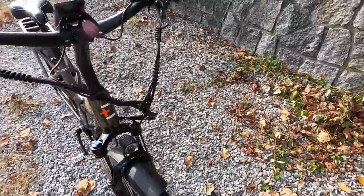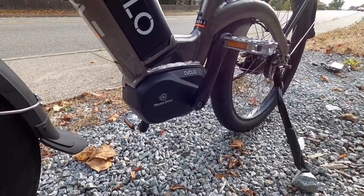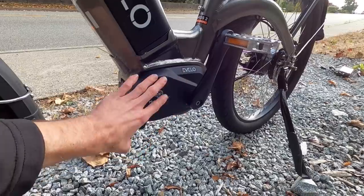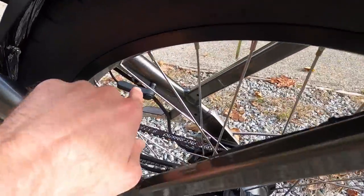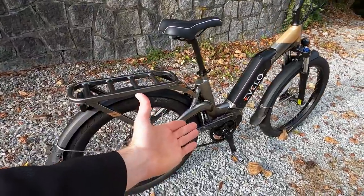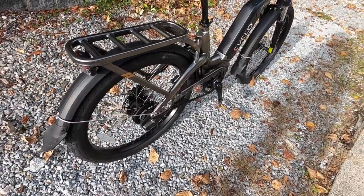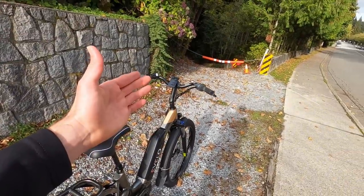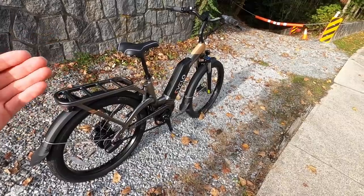It's a multi-sensor — this thing is measuring your pedal torque as one of the primary signals, but also rear wheel speed and pedal cadence, and it combines those. At lower speeds if you're pedaling slow, it's really listening for how hard you're pushing. If you push hard, it's gonna accelerate quickly — it's very dynamic. This thing doesn't have shift detection, but it kind of doesn't need it because you've got the continuously variable transmission. You don't have a derailleur, so you're not gonna bend the teeth on a cog. It won't necessarily shift right away under heavy load, but if you ease off a little bit, the motor eases back as well, and that makes shifting happen really smoothly.